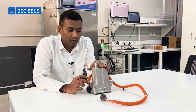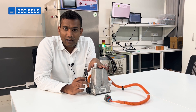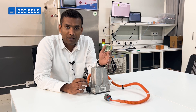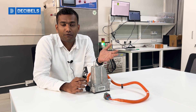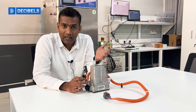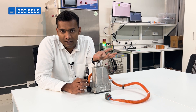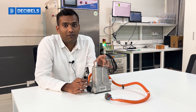To make this happen, we have components like the one shown here. This is a component from Tesla that is basically a battery heating system. We require a heating system because the temperature of the battery can drop below zero degrees Celsius in different countries. When the temperature is that low, the cells inside the battery pack also drop to that lower temperature, meaning the internal resistance of the cell has a direct relationship with the temperature of the cell.